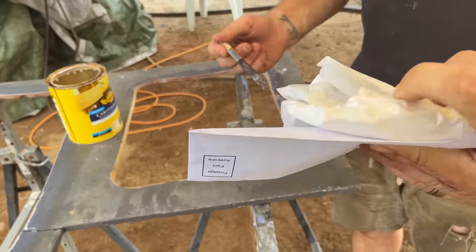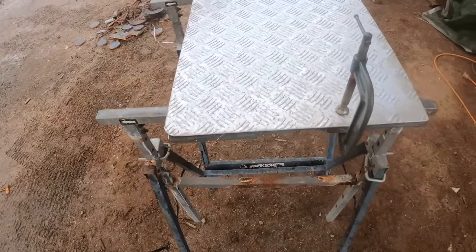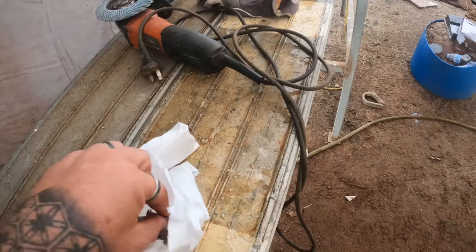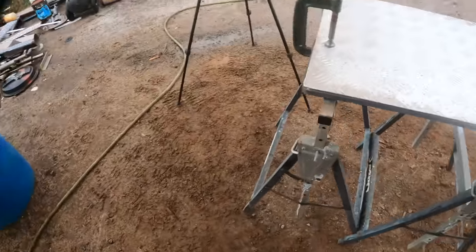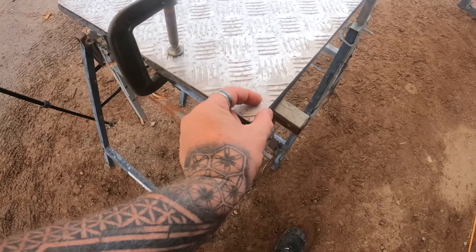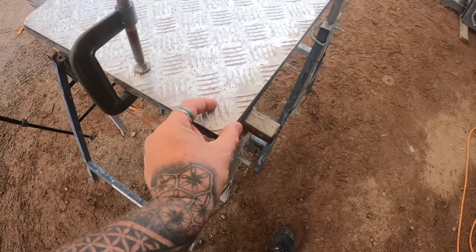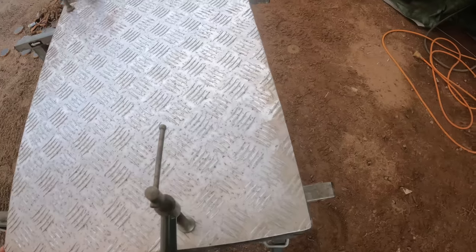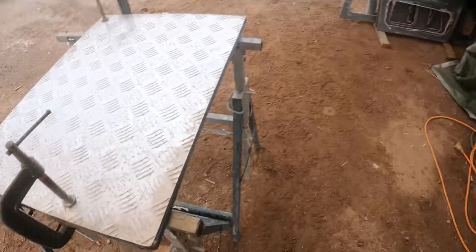Stack and stack of nuts and bolts. Excellent. So we've got all the metal washed off as best we can. What we're going to do now is put some stainless steel bolts and washers and nuts into these. We've got to be mindful that the frame that these are sitting on is 15 mil wide, so I need to come in 30 to 50 mil for the bolts, so they don't conflict with the mounting brackets that are already there. And I'm going to do this for every single one, so here we go.